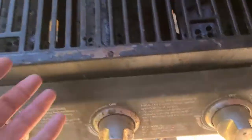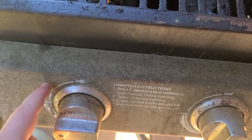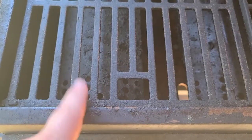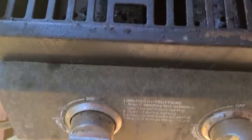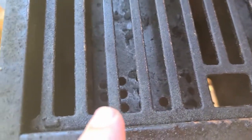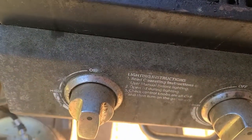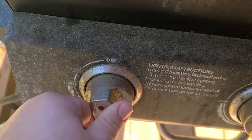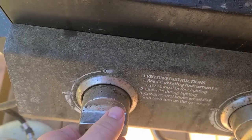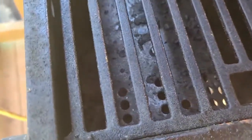Don't ever leave the lid closed because it can let the propane build up. But as long as these knobs are off, no propane is flowing. If you press this and turn it, you'll hear it click. It didn't light that time, but if you listen you can hear the propane flowing. All you want to do is come back and click it again. Sometimes I have to roll this knob, push it in, and click it once or twice to get it to light. As you do it, you'll understand it a little more on how to handle it.